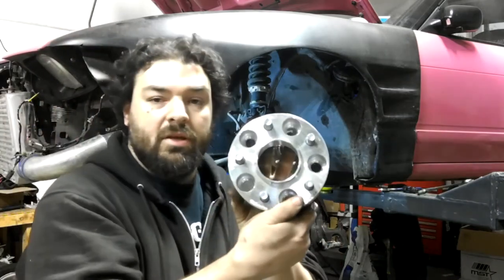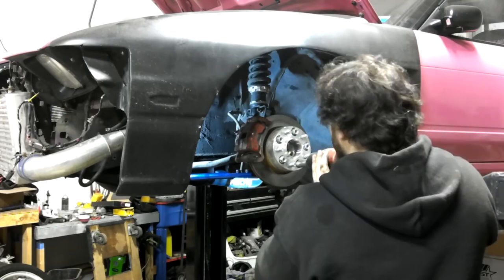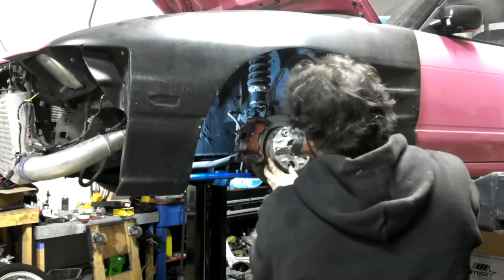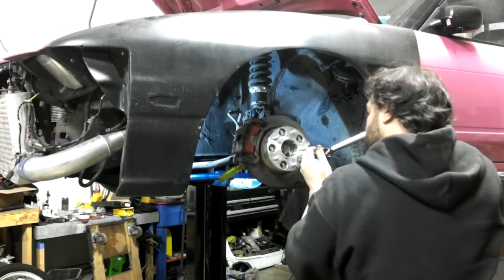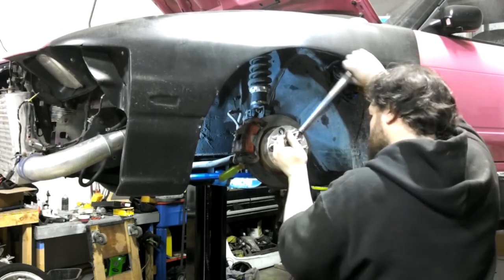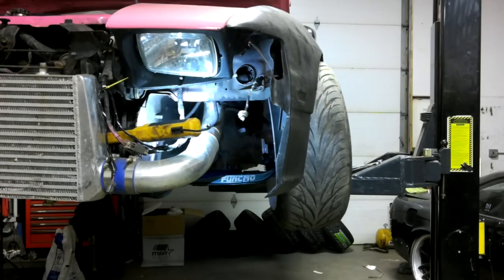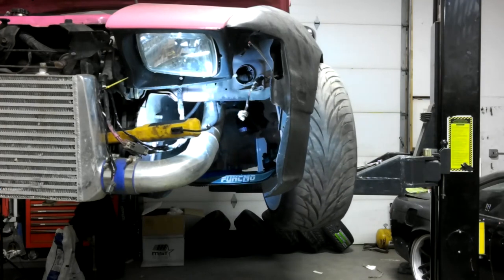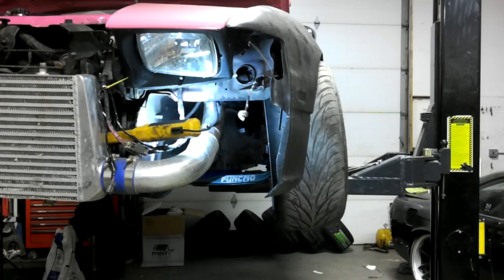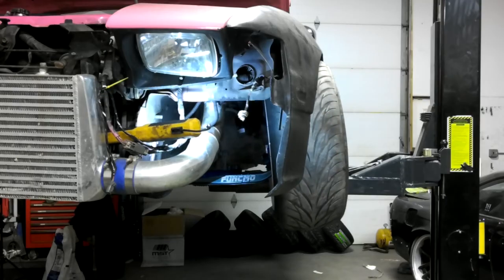That big mamma jamma, huge space. With extended tie rods and offset rack spacers, we achieved approximately 60 degrees of usable angle before the wheels hit the sway bar. You can increase this angle by using a blade style sway bar or offset tension arms.